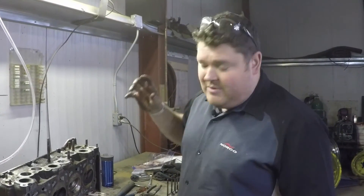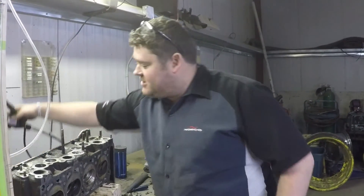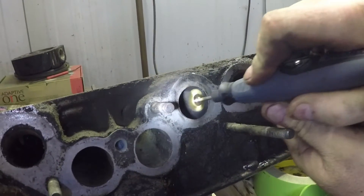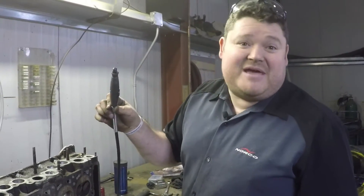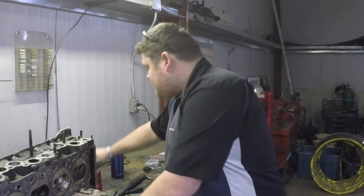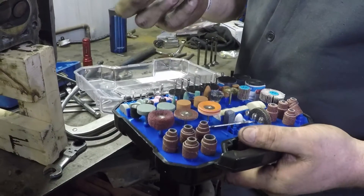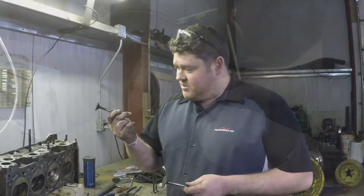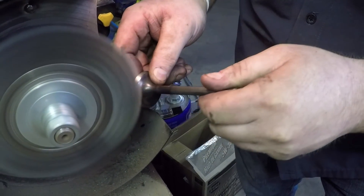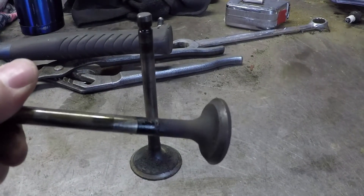We now have the chambers all cleaned up and all the carbon removed from the valves. Now we have to reassemble it and put it back on there so we can see if there's any changes in our flow. How we got there: we used a Dremel with a neat little wand attachment so you can get in these tiny ports. As a comparison, on a North American V8 you can use the Dremel itself to get in there, but on these you need this attachment, which I find kind of funny. We used sanding drums as well as tapered cones to get in there and try not to remove any aluminum — just remove as much carbon as possible. How we cleaned the valves was to just take the dirty valve, put it to the grinder and wire wheeled all the carbon and crud off them down until they were back to new. We also found a substantial carbon ring around the edge of the valve, and we're hoping that that was impeding some of the flow on the intake valves.